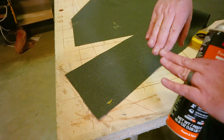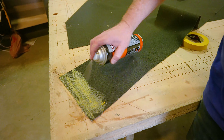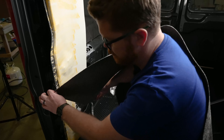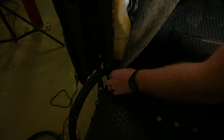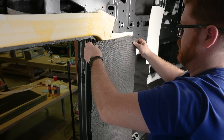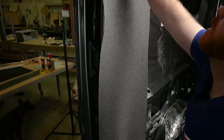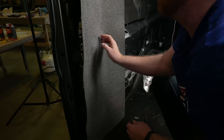When I'm starting a fabric-to-fabric joint, I think it looks best to have a rolled edge, so I'm going to pre-spray some of my fabric on the table, let it off-gas for a second, then have a nice folded edge. After spraying our fabric outside the van, I'm ready to start applying. Just like with the Landau, I'm going to start at my bottom seam, making sure I have plenty to wrap around the pillar so there's no dry spot. I'll attach it to the first plane, stretch vertically, get everything nice and even, give it good tension, tack it in place at the very top, then work our way back down — one plane at a time.